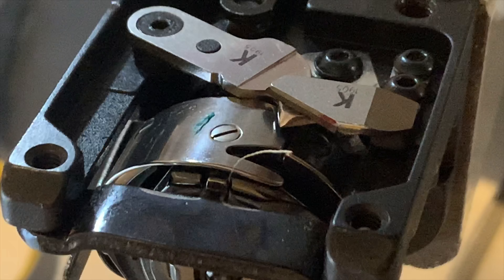The reason for this is that both blades work together with friction. With the normal use of the trimmer mechanism, the two blades wear together, making a unique and compatible wear between them. If you only replace one blade, there exists the possibility that the trimmer won't work properly due to incompatibility of the blades, since one blade is new and the other one is worn out, even if both blades have the same letter on top.